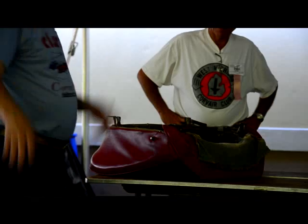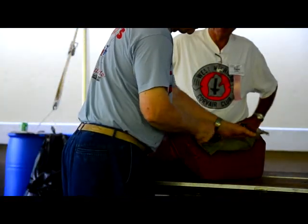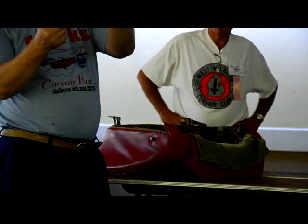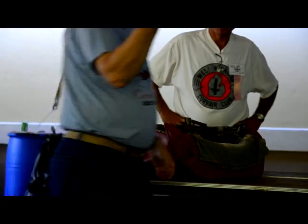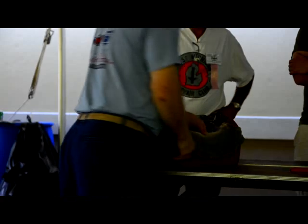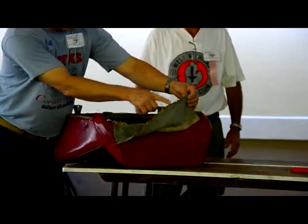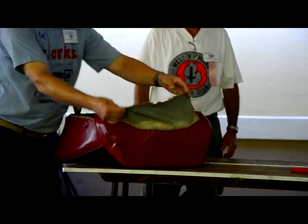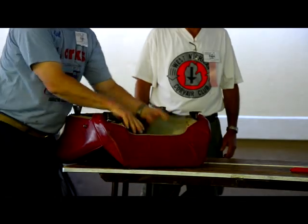So you would hope at this point you've done all your hog rings. You're not even halfway yet. Now, we do need to save this. Normally I would suggest that you sand it or glass bead it a little bit. They're always rusty. They didn't put anything on them. That just came out of this piece here, and you'll see that the rust is eaten right through where it was supposed to be, so it was just barely holding it anymore. But that would pull it around like this and smooth out the back side of the seat.